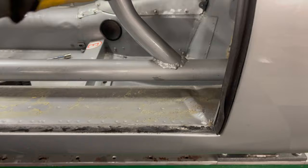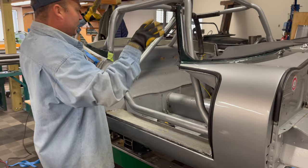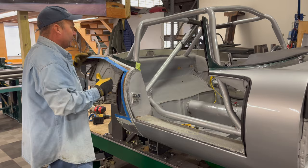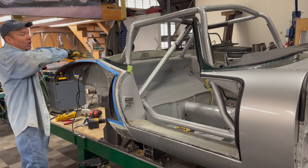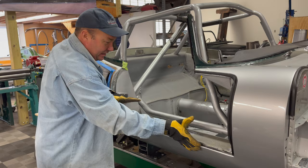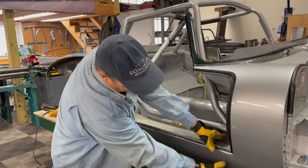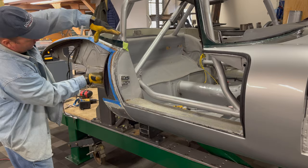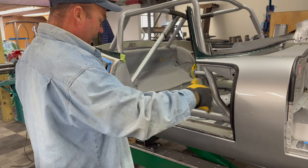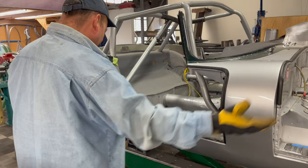I've figured out what basically happened. The roll cage held the floor and everything pretty much intact — you can see how it ties the forward bulkhead into the rear chassis legs, with just a little wrinkling right here. When the wreck came in, it crushed all this stuff but the cage stayed intact. However, it did send kind of a shock wave down through the shut face and down into here. The sill from this section up into the shut face has kind of gotten shoved forward, and that's why the door doesn't fit anymore.